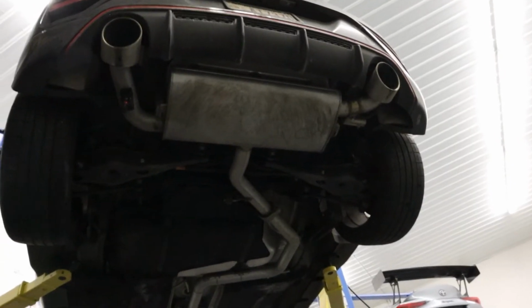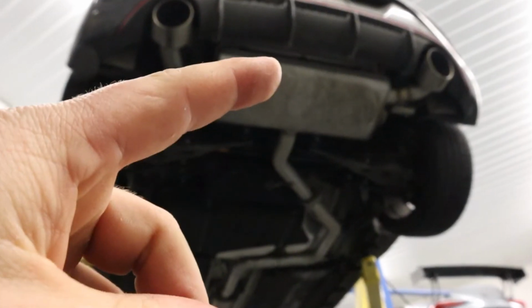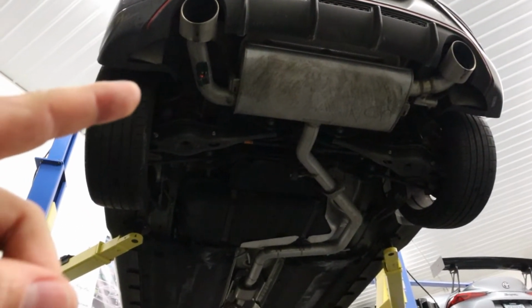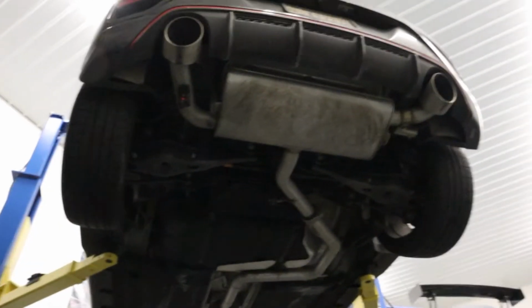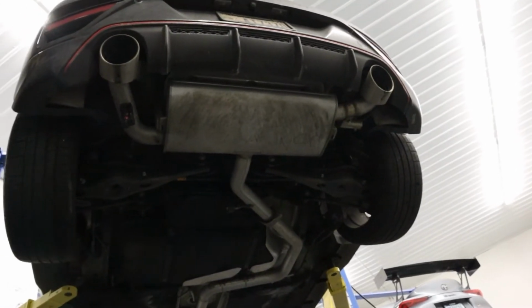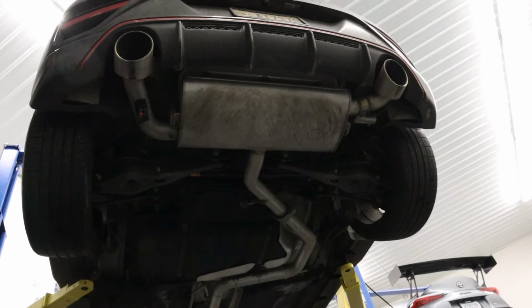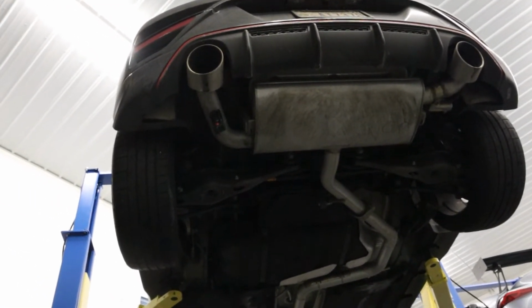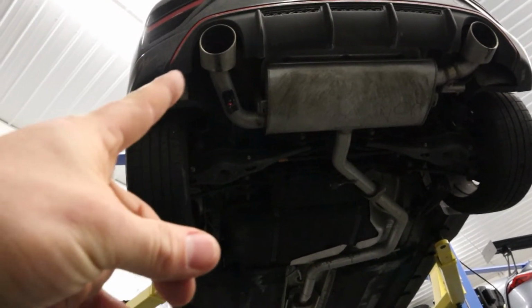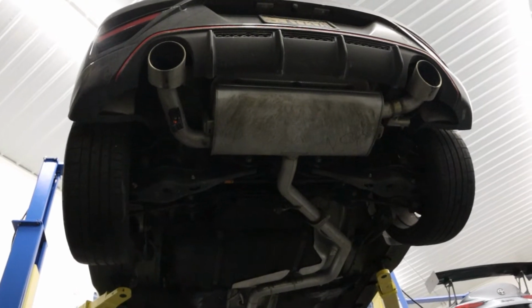To begin, this is where the rear bracket's gonna install, and we'll get close-ups here in a second. And then the side brackets end up going on the frame rails themselves, and that front bracket will go over the exhaust right there. So we'll get some close-ups of us installing the brackets. You may notice that we will have to potentially tap, and they are M10 by 1.25, the bolts up there. But otherwise, the install is gonna be pretty quick and simple.